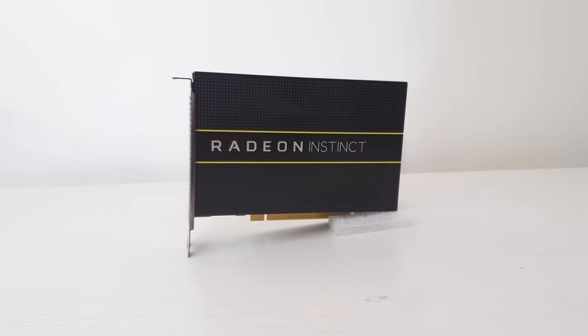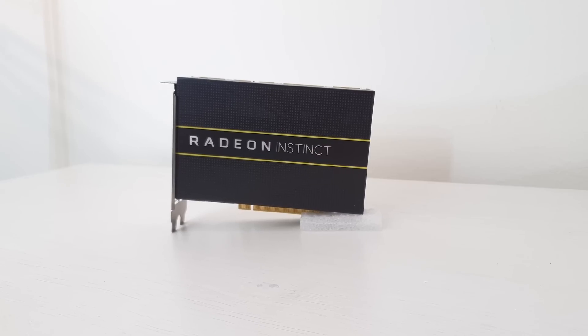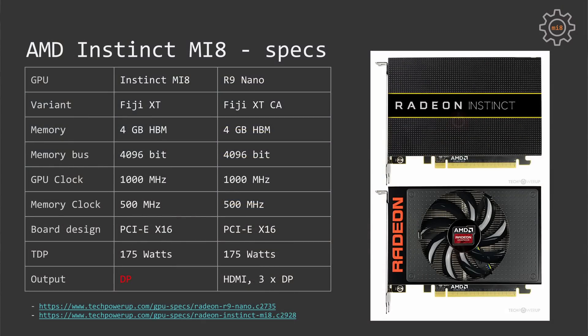Let's go into the MI8 review and first figure out what this MI8 graphics card or device is. Looking at the TechPowerUp website, we can figure out that the technical specification of a Radeon Instinct MI8 is basically identical to the AMD R9 Nano graphics card — everything exactly the same except the GPU cooler. MI8 comes with a passive cooled heatsink which cannot work in a regular PC due to overheating. Another difference is that MI8 has only one DisplayPort output, while AMD R9 Nano has a few video outputs. So we have a hope to turn this AMD Radeon Instinct MI8 into an AMD Radeon R9 Nano and get performance somewhere between GTX 1060 and GTX 1070.